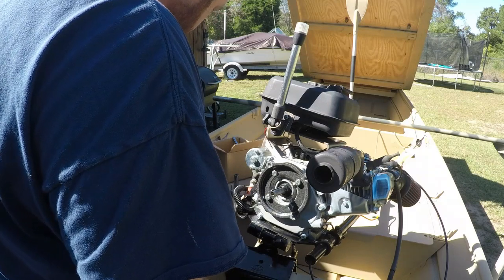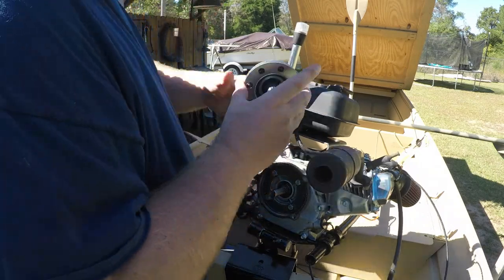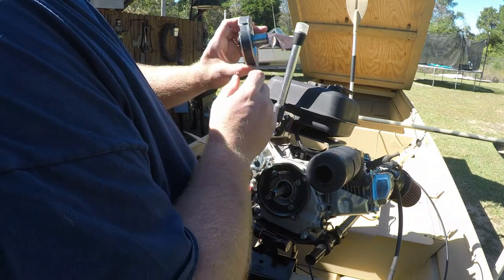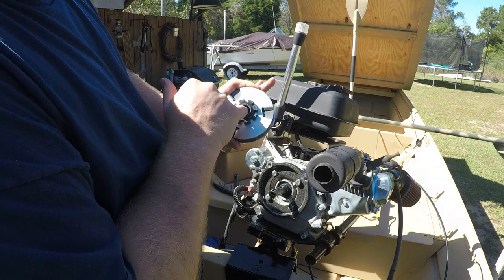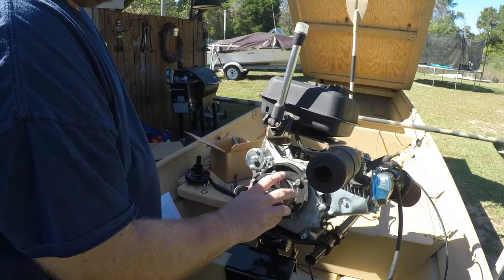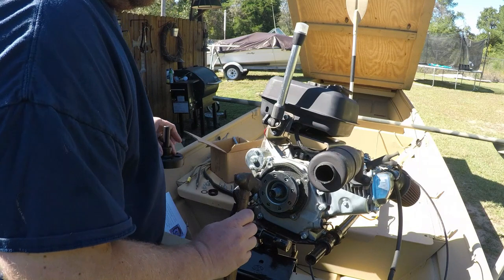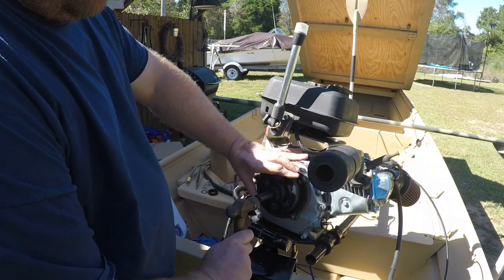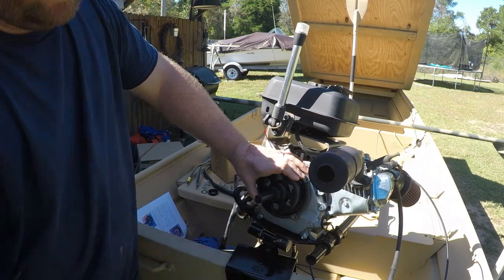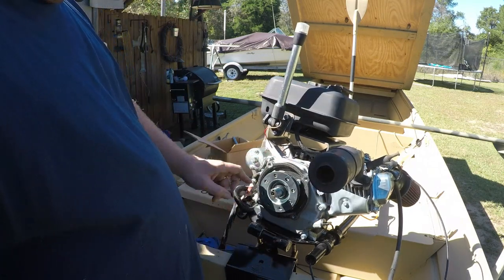With spacer I in place, next we slide on the clutch pad assembly. This side faces toward the motor and this side faces toward the propeller. Inside of it you have a built-in keyway, so align your key up and slide it into place. If you've got to give it a little love tap to get it in, place the other clutch component on and tap it right there on the edge. Give it a good firm hit. That's attached to the crankshaft of the motor.